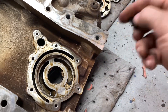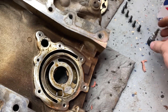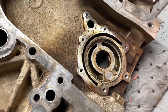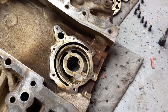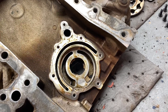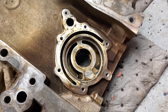By the way, if you're doing this by yourself, they're actually pretty tight. You need a T27. A T25 — I was putting it on there and it was just a little bit loose, where you could tell you could probably bump it up another size, and it felt like I was going to strip them out. Once I put the T27 on with a three-eighths ratchet, you actually have to put some force into taking these off. You think you're going to break them, but it's either you break them or you get them out. That's how it is on these old oil pump bolts. You just gotta give your force and you'll break them free. Don't feel like you're going to break them when they break loose, because they are just naturally that tight from wear. At least I'm happy I didn't break that, because that would have ruined my day for sure.